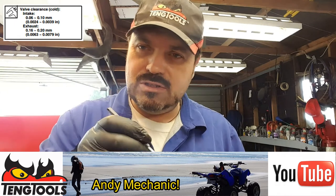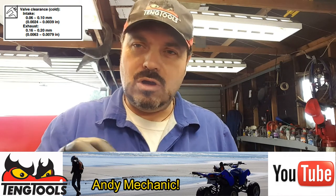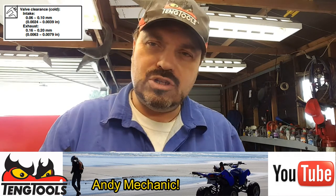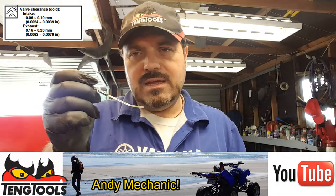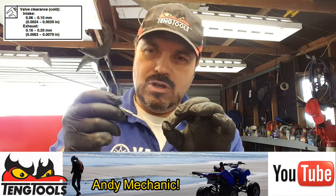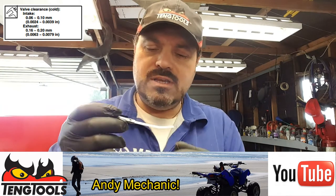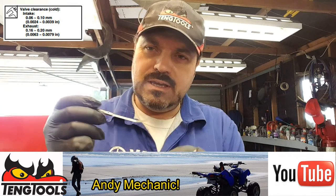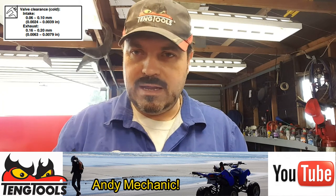Now, obviously, if this doesn't go in the gap, the clearance has reduced, and I need to undo the lock nut and wind the little adjuster out a tiny amount until the point where this slides in under very light resistance. You just push it in, and if it buckles up and won't go in, then the gap's too small. And if it just flows in without any kind of distortion to the feeler gauge, that's an indication that the gap is too large and we need to bring it back down a bit more.